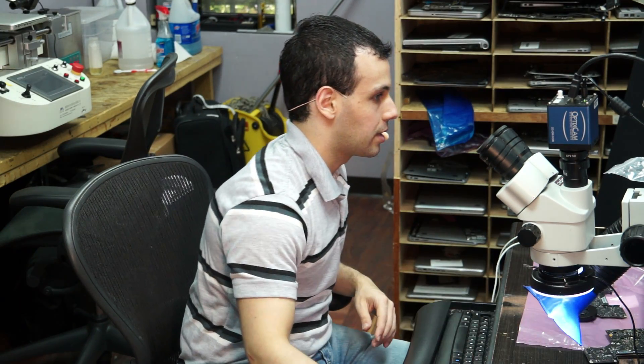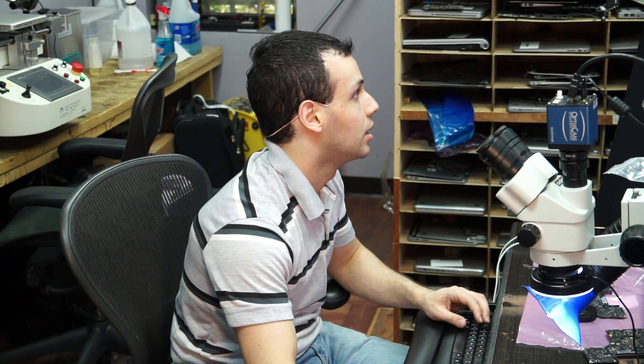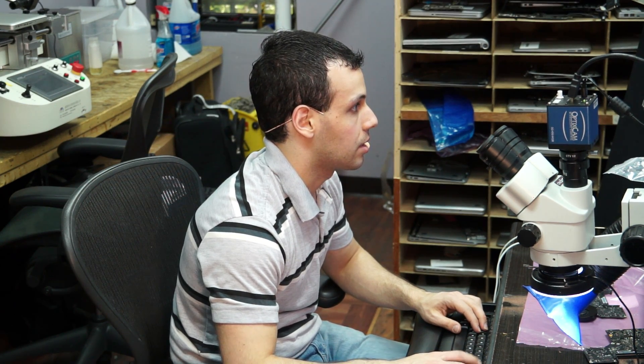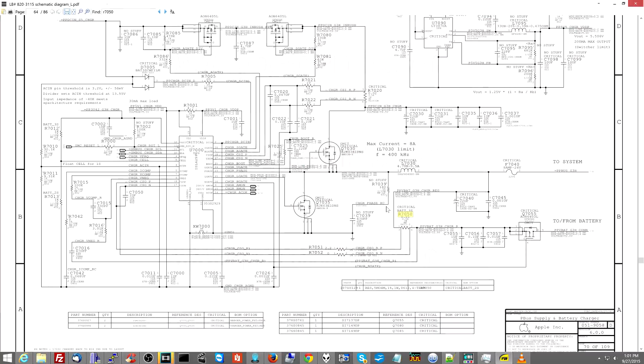So just to show you a little bit on the schematic — because I feel bad not showing you what current sensing is. I'm not going to explain it in detail here, but I will explain just a little bit so you can get an idea. So let's go to Open Broadcaster — I have to plug the dedicated monitor in. So these are the resistors: R7051 and R7052. You have Q7055 to and from the battery. This is a current sensing resistor. Before the battery goes to the computer, there's a resistor right over here. There will be a small voltage drop across the resistor, and that voltage drop is going to be dependent on how much amperage — how much power — the system is using.